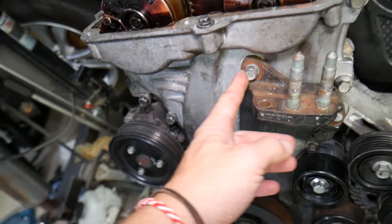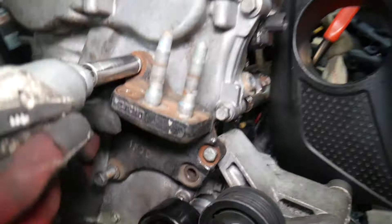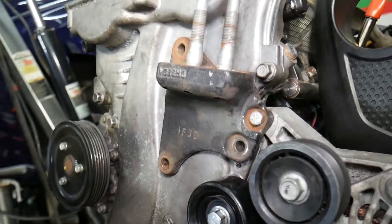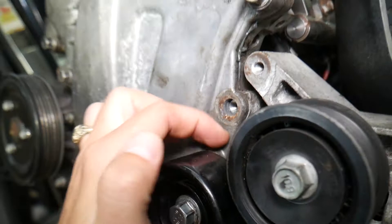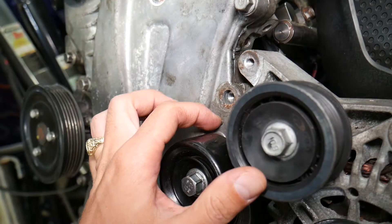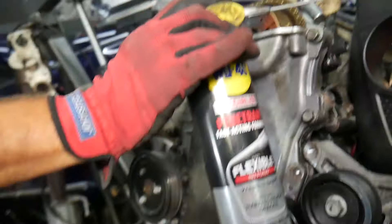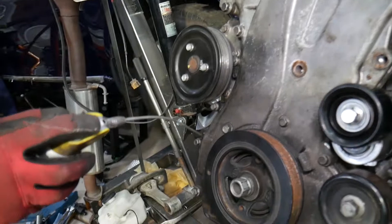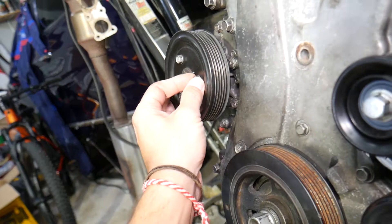Remove the engine mount bracket — Hyundai and Kia use 12, 14, and 10 millimeter bolts, so everything here is 14 millimeter except one bolt someone replaced with a non-metric standard bolt. There are alignment guides for the timing cover — spray them with penetrating oil so it can soak in while you work. Those guides build up quite a bit of rust, and if you don't spray them, the cover can get so stuck that prying it will crack it, which is expensive.